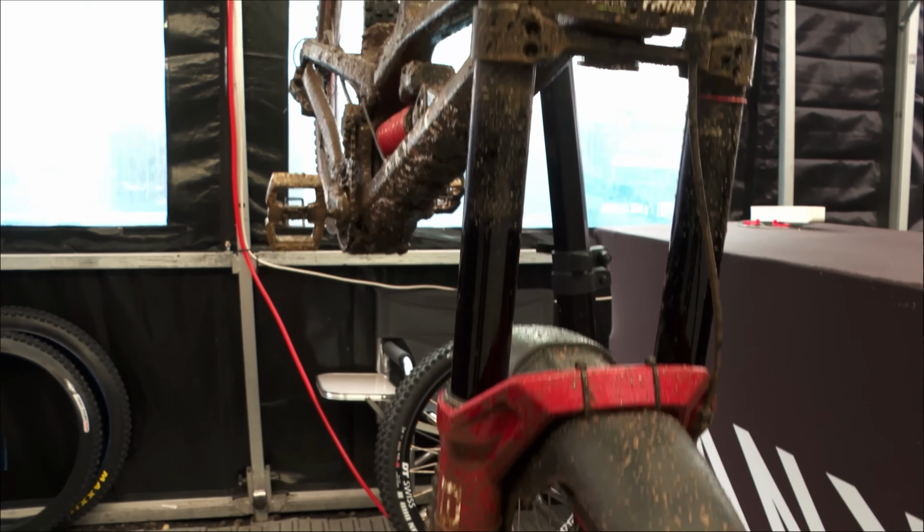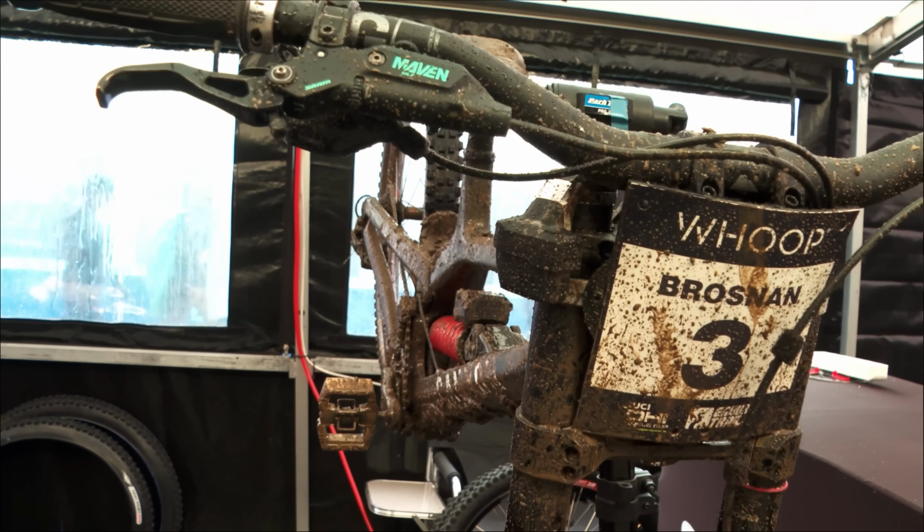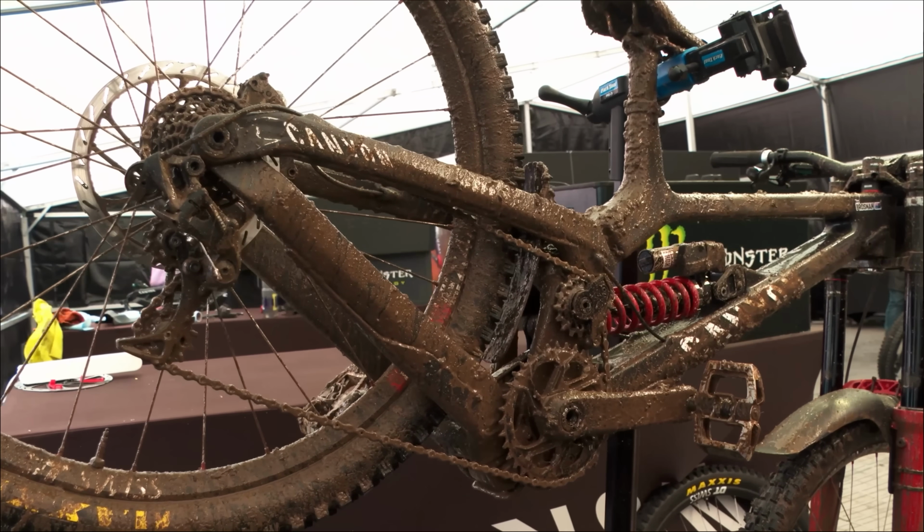Okay. Did you talk about doing adjustable chainstay length? Because I think that's something that's been offered. We did. It was something that we were into, and we quickly realized that for racing, it's something that we were barely ever using. So that's why, when it came to the design, we came down to the option to get rid of it, to optimize our kinematics, because we realized that yes, front center is crucial for the reach, the stack, the possibility of the head angle. But in the end, the chainstay one was not something we were using a lot. So that's why we got rid of it.